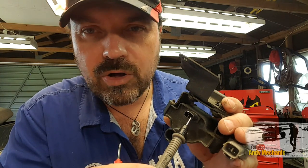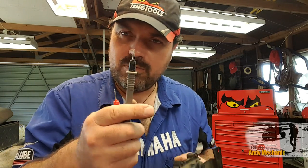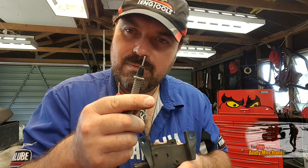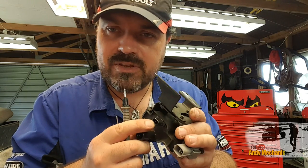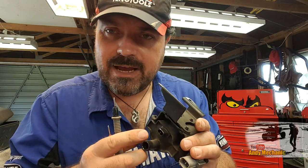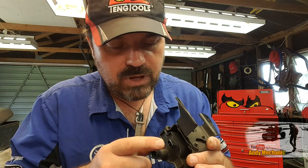Okay, so grab your ignition coil — don't drop them because they get really upset if you do that. And we're going to put a probe on each of these two connections in there, one on there and one on there. It's really important that you get a good connection, and if you've got the probes that have the little crocodile clip fitments on the end, use those. I'm going to mount this in the vise because I'm going to run out of hands.